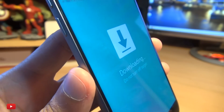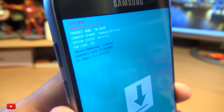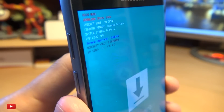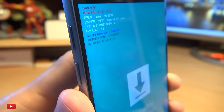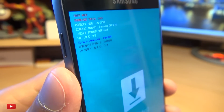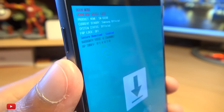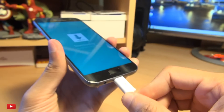It's not actually downloading anything — it's waiting to download once you've got it connected to your computer. It says Odin mode along the top, and it gives you the product code as SMG930F for this particular Samsung Galaxy S7. Now this process will trip your Knox counter and it may void your warranty. So do proceed at your own risk.